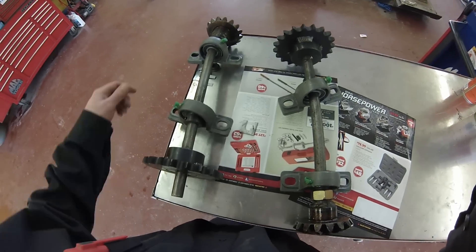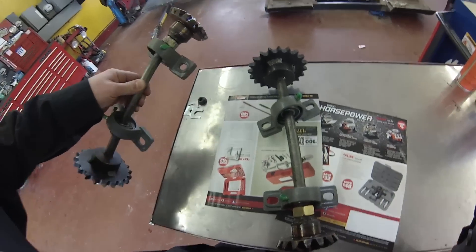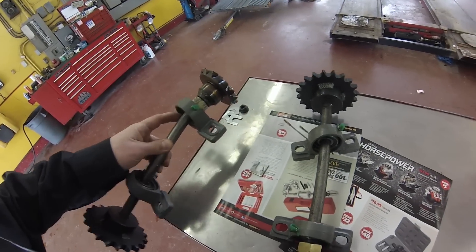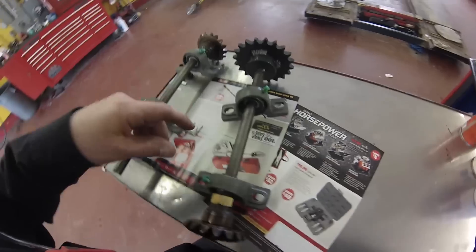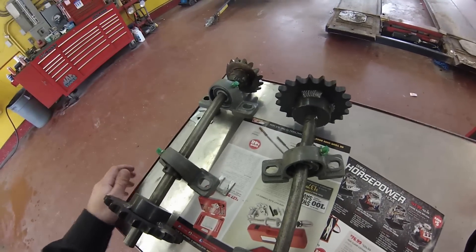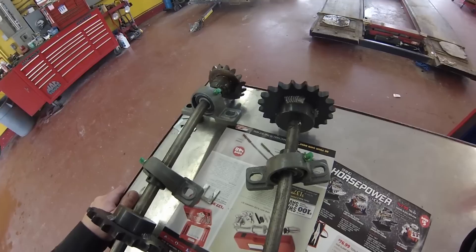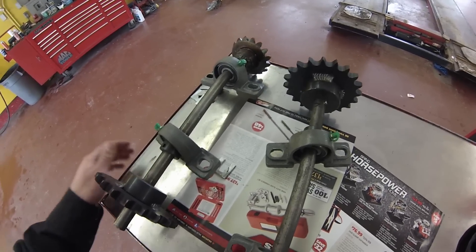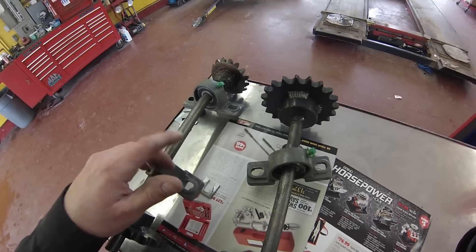And here's some of the bad news. When I tried to drive it, it just completely mulched my jack shafts — bent the hell out of these three-quarter inch shafts, both sides, pushed the spiders apart and they just ratcheted, and basically it stopped moving within about 10 seconds of driving. So this means I'm going to have to totally rethink my gearbox system.